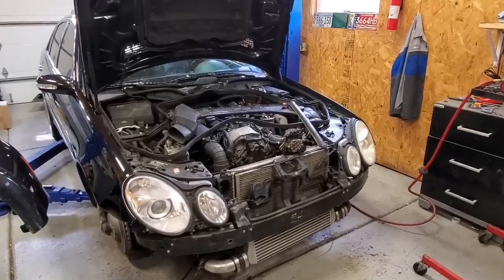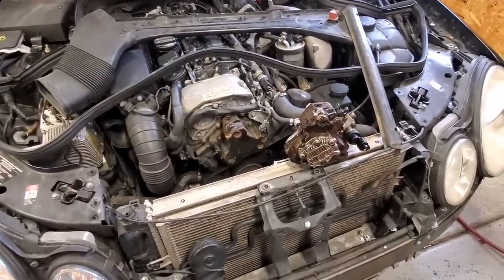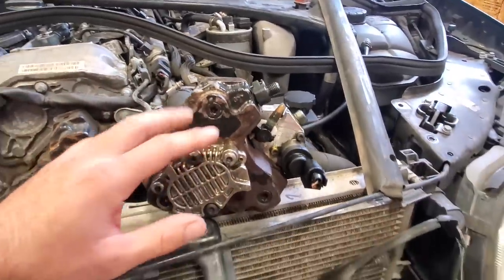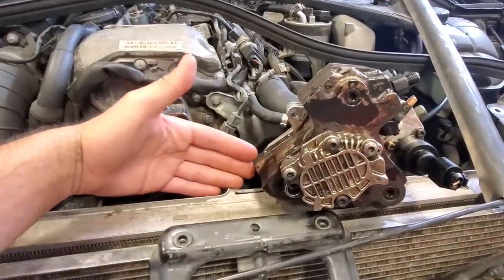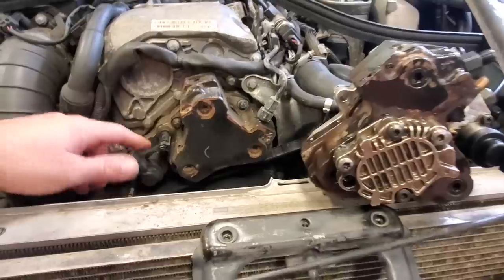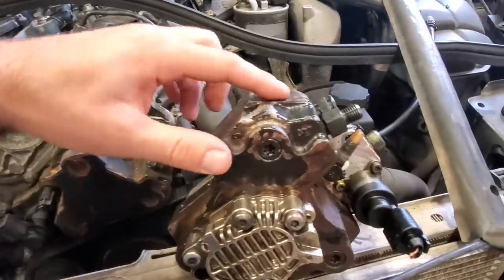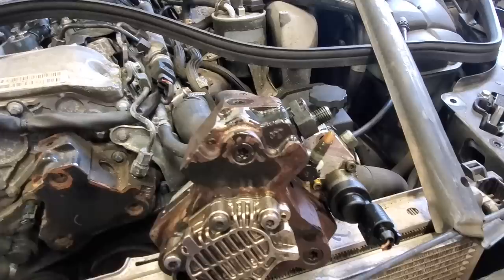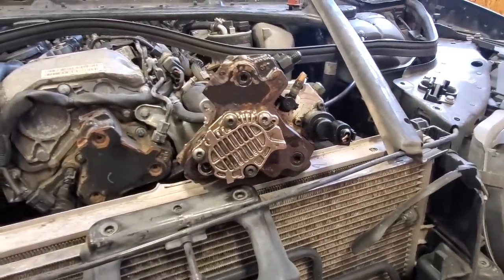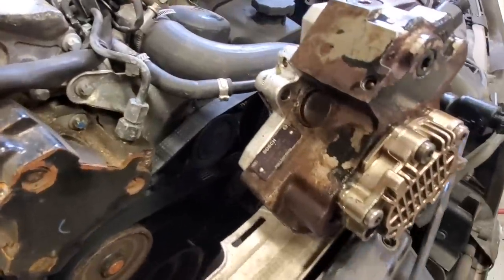Welcome to my diesel life, guys. This is super frustrating but par for the course for this project. I meant to install this high pressure fuel pump right now, but looking at it I don't see how that's physically possible. When I got this pump I knew there were some modifications I needed to make — for example, grinding away a portion for the fan to fit. But now looking at the fuel line connections and other connectors, I just don't see how this can work. I'll put the part number down below in the description box — maybe one of you can help me out, or email me at Legit Street Cars.